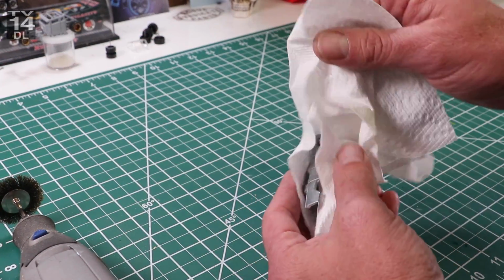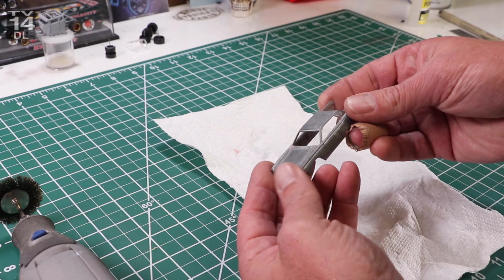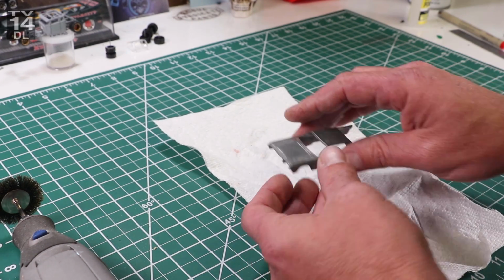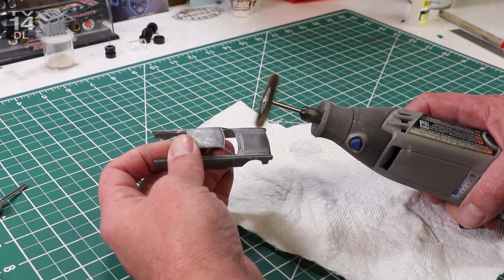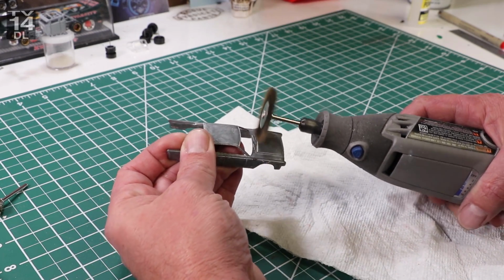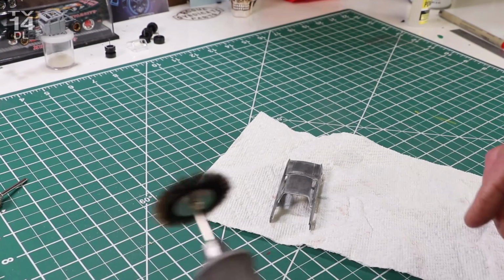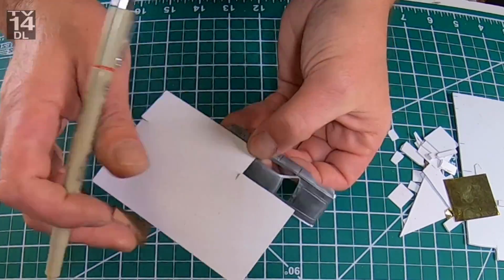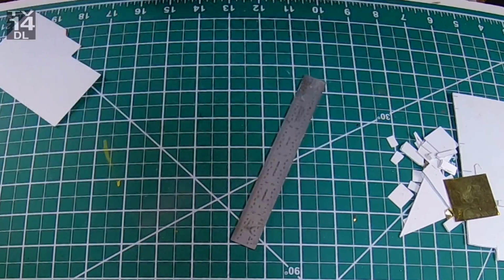After it comes out of the citrus strip, now it's just a matter of cleaning the remaining paint off, which there usually isn't any. Sometimes there's some residue from the citrus strip, or there might be a few pieces here and there. Cars that have a lot of body lines, or doors, in this case multiple hood lines, deck lids, stuff like that, you want to make sure you clean in there really good, because paint will not adhere to citrus strip.